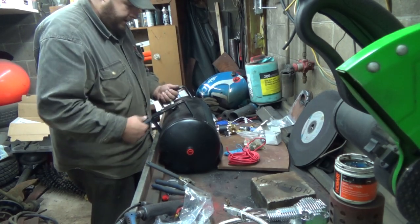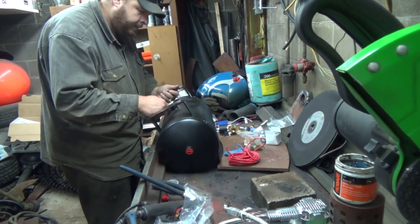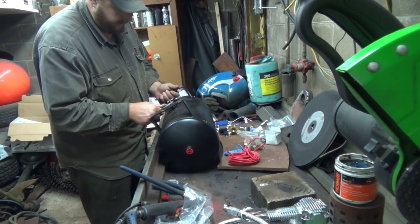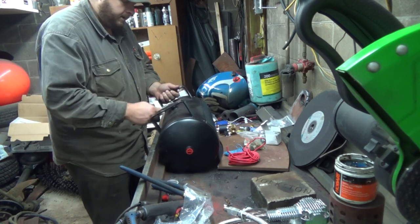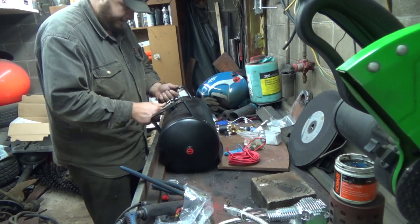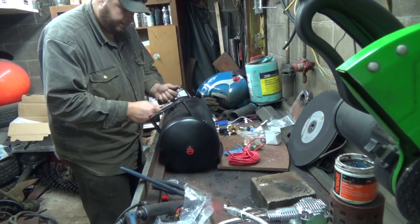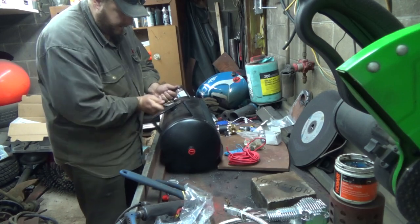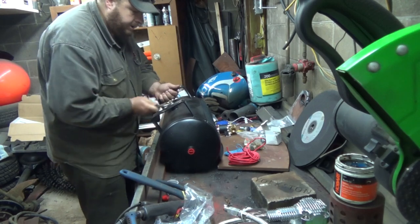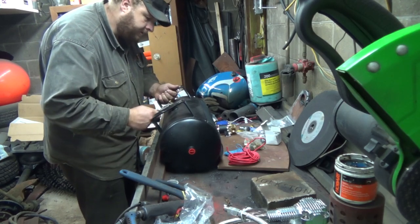So especially if you're painting, it's not good mixing that with your paint, right? Or sandblasting, it's like a complete nightmare if you're sandblasting, because your sand all bungs up in your lines and then stops your sand flowing. You'll get lots of air, but no sand coming out. Not a lot of fun. So hence why we put air dryers, which technically this should have, because it is an air compressing system now. It should have an air dryer somewhere, but if you keep your tanks drained out, it's usually not too bad.